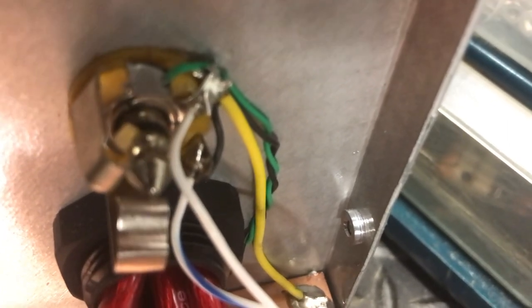When it comes in, for a second that tip hits that hot wire and it can be hot. It also depends on how the remote's wired. But just to be on the safe side — before you put your amp in, plug this in first, then come over and apply DC power. Then your remote's on, that whole line's got 12 volts, and nothing makes the amp slide up — so if you pinch that line anywhere you can cause problems.